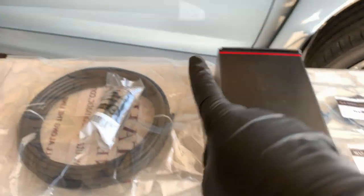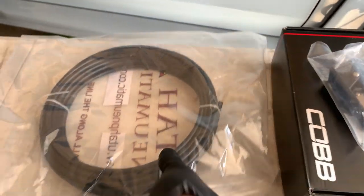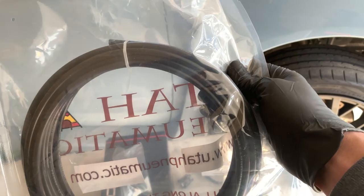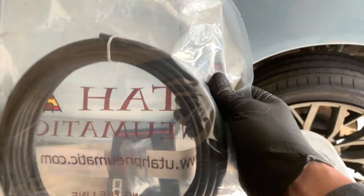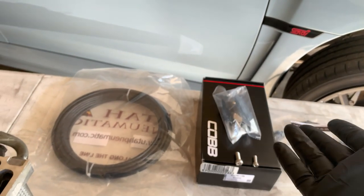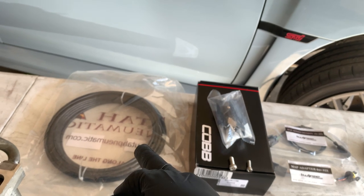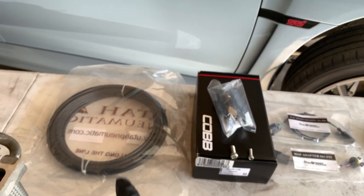Here's the flex fuel box we just did. And here's what I'm talking about — this is a cutter for this plastic line. This is quarter-inch hard plastic line, which is what we're going to be using for the vacuum system on this car. That way we can just push-lock it in and not worry about blowing off a vacuum line or ballooning vacuum lines. It's also a lot easier when you're taking the car apart — you can just push them in and pull the line out.